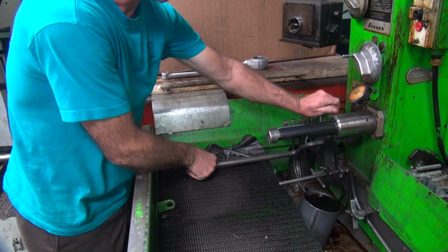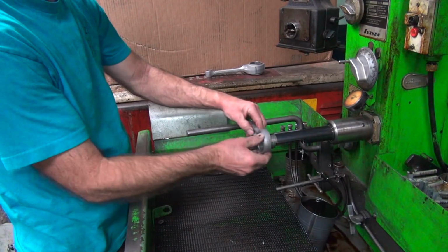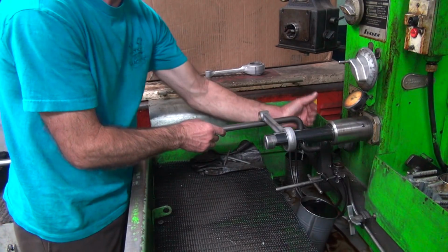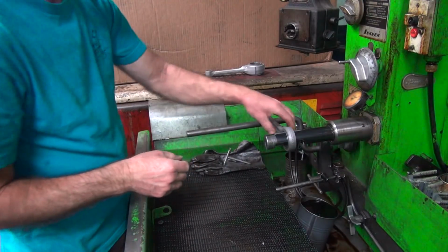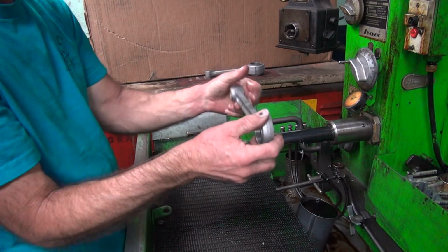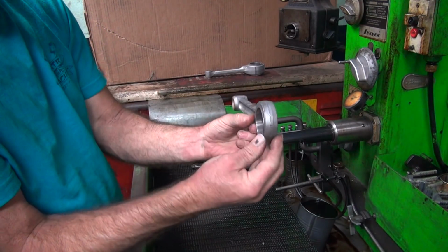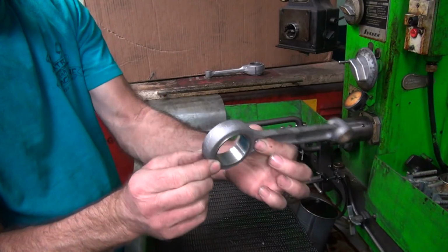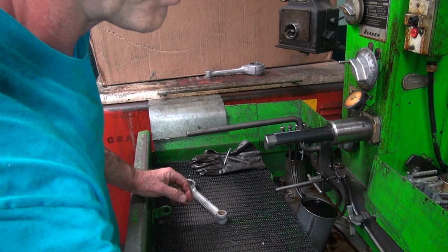Okay, this one here we're going to use a rubbing arbor over here. Rod goes there, rubs on here. There you go. That way you don't have to hold it and jerk on it and knock it out of true. Now if I yank on it like this, it makes this oval, barrel shaped. So you hold it right here to go as evenly as you can. Try not to screw it up.